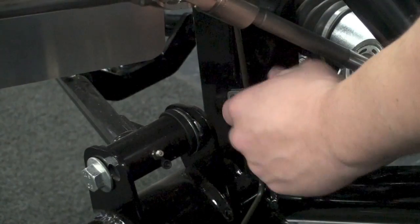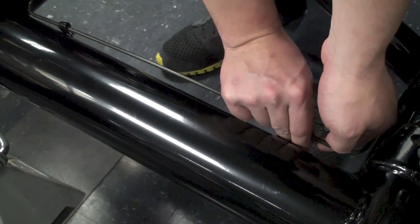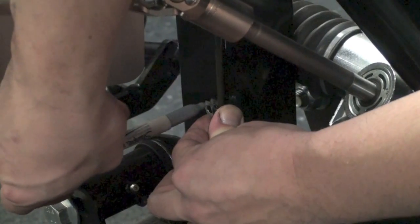With the front line now bent, find the 3/16-inch insulated clamps, mark a couple of spots on the frame, drill through and pop rivet the clamps to hold the brake line in place.